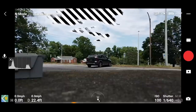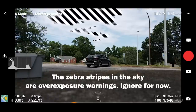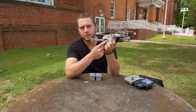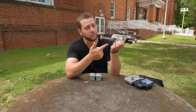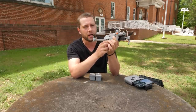Now that you've connected the drone and started the DJI Fly app, it might ask you if you need to update the firmware. This is also a time where you can make sure that the image is working properly before you go out to fly. There is a micro SD card slot in the drone, and if you plan to record a lot of footage you'll want to make sure your micro SD card is in the drone in the side door. There is about eight gigabytes of internal storage which may get you by.